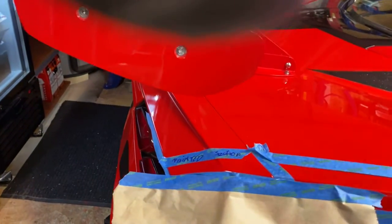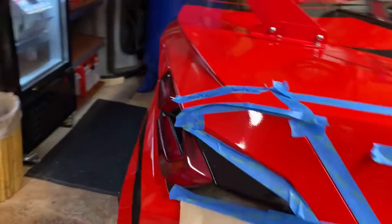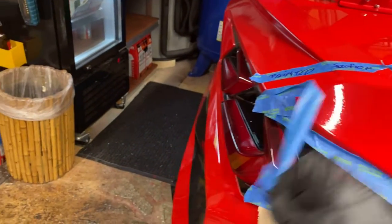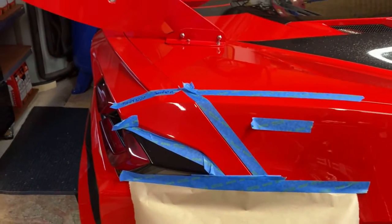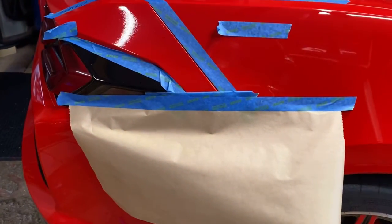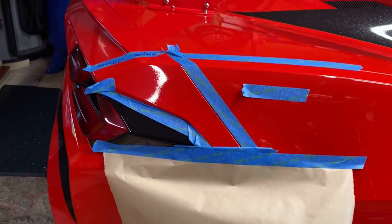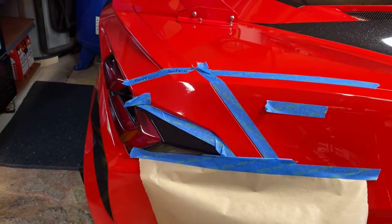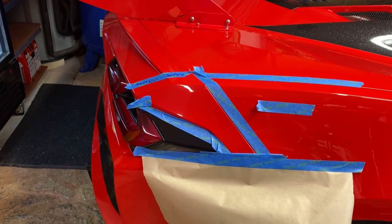As I was getting ready to blend it with clear, I removed that section and the soft tape line. Then I used clear to blend where I painted over the corner and down to this short area where it's a soft line and I can buff it out. That's a brief explanation on soft and hard lines when you're masking off a project to paint.